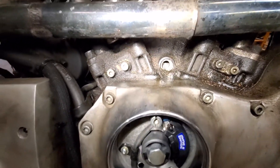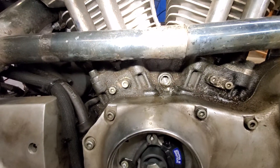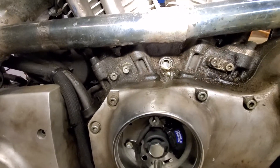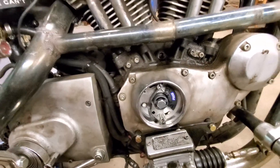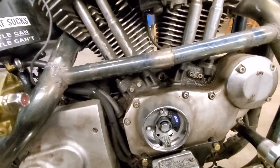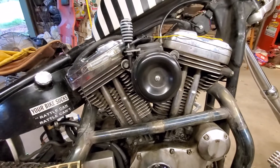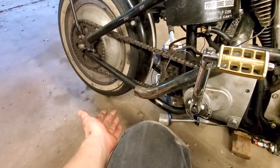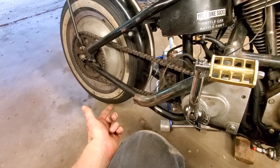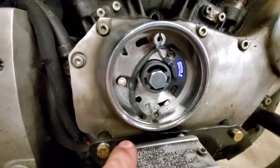It's kind of on the left side of the window there — I don't know if the camera is really focusing on it. I'm on top dead center, the compression stroke, more or less. I got the plugs out, held my finger over the plug hole in the front cylinder, got the bike up on a jack, it's in fifth gear, so I was able to roll the rear wheel back and forth a bit.